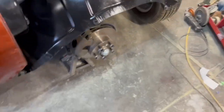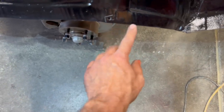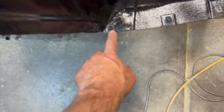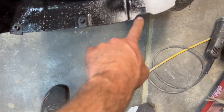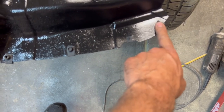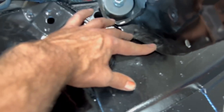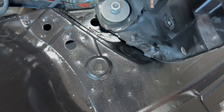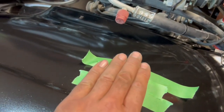So what I'm going to work on doing next is getting the fender put on. A few things to keep in mind — on the '67 and '68, these nuts are actually part of the fender, so make sure they're in good shape. You'll have two styles here for the three-eighths bolts or five-sixteenths bolts, and you have two here for the screws for the turn signal lens. So you've got to make sure those are put in first before you put it on. Now my inner fender — I put these bolts in here, but they're loose; I can still move this thing around if I have to. It's not secured down super tight. I put some tape on the inner fender so when I go to put the fender on, I don't scratch the paint up real bad.